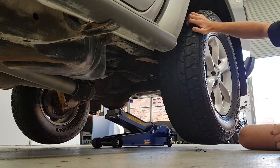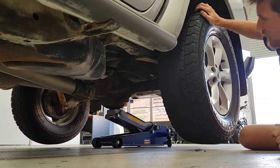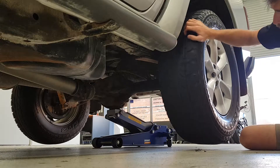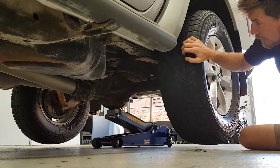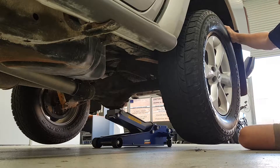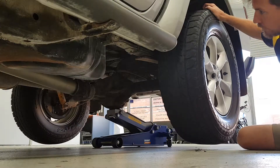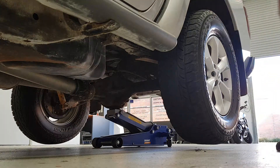We've got the forward lock again, we'll go backwards — there we go, that's locked back in. Now that was about at least a quarter of a wheel turn. So if that was under load, it's probably putting a fair bit of pressure on the locker there — you could cause it to damage it internally. There you go — Harrop E-Locker.